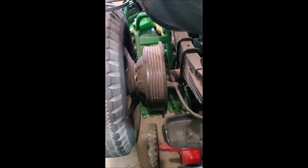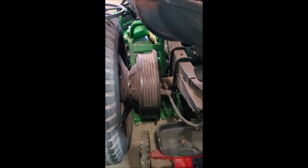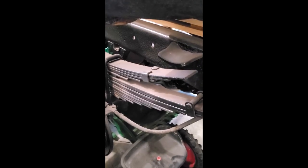Like I said, wheel cylinders are replaced. I turned the drums on my lathe just to dress them up. The shoes were in really good shape. Everything else was in really good shape. The rear end is all done. The springs have been repacked. Those are new U-bolts that are holding it on. None of those leaves were broken. I just had Watertown Spring, a local spring place here, repack them. There's new oil on the rear end, all new brake lines up to about midway here.